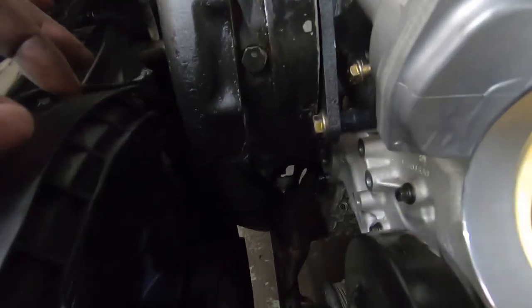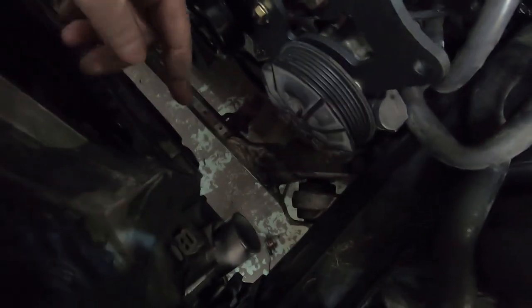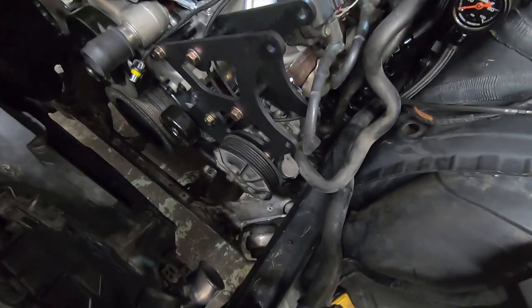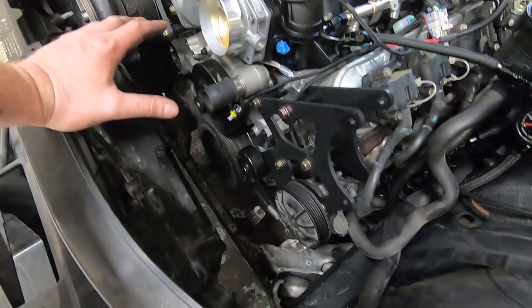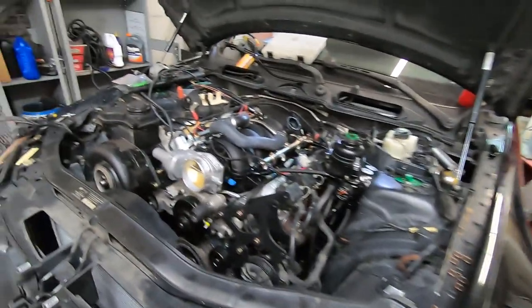I'll raise the car up here in a little bit. This one here probably needs like a 45 degree 3-inch silicone, and we could make that work. This one here, we just literally go 90 straight up. There's nothing that's going to be right here over into the intake manifold. Super easy. Besides that, we're looking pretty good. I do need to make the wire that runs over to the alternator.